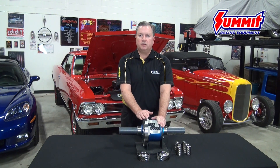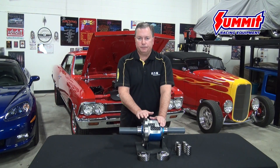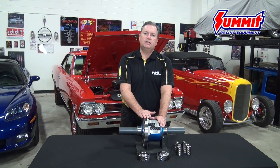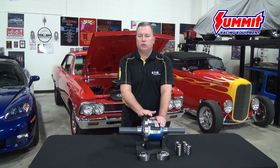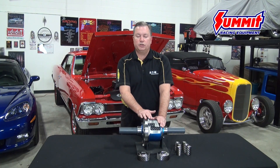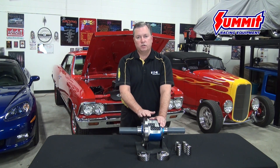One other aspect of a limited slip differential you always want to keep in mind is proper lubricant. In the case of the TrueTrack, because it's not using conventional clutch plates like other types of limited slip designs, you've got a lot of flexibility in the type of gear lube you want to use. We always recommend a high quality product — these days you'll see designators such as GL5, which we would highly recommend. Whether it's a mineral or synthetic-based lube, a good quality product typically in the 75W90 or 80W90 viscosity range works very well.